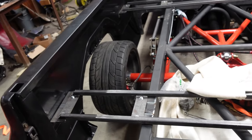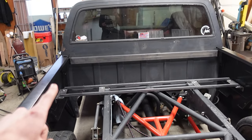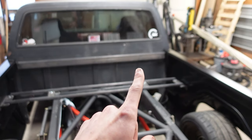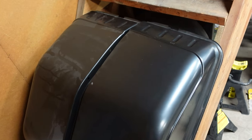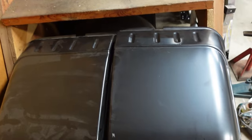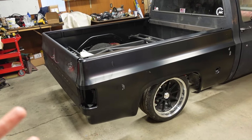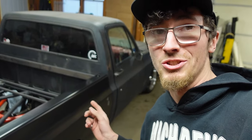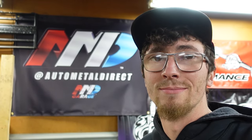To mount the box sides I have a brace along the front and the back for the new bed height, a one-by-three chunk running across the back, and another one running by the tailgate. Auto Metal Direct also sent me a set of their wider wheel tubs — these are four inches wider than the factory wheel tub, so you can fit like a 14-inch tire underneath, and someday soon that will be in the cards for this truck. A huge thank you to Auto Metal Direct for sending those out — they have everything to make a full square body, so definitely check them out, link in the description.